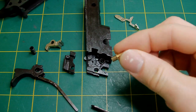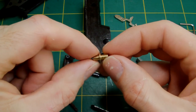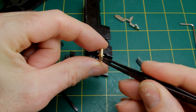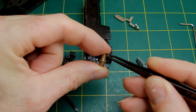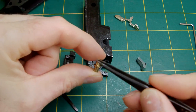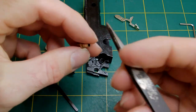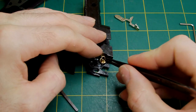Then all you do is you get the brass tube — sear post, whatever you want to call it — that goes down through the center of it. Now there's a straight shaft on one side of this washer and a stepped shaft on the other side. The straight shaft is the section that goes down inside that spring. So the step side stays facing upwards. It's only the straight shaft that goes downwards. So you grab the brass piece and put it in like so.